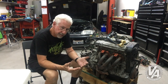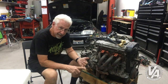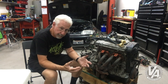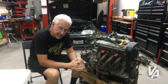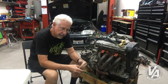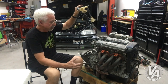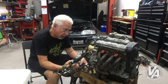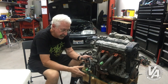We need to wire the harness for the engine now. The engine harnesses for the DX models are unique depending on the year: 88 DX harnesses are by themselves, 89 DX harnesses are by themselves, and then 90-91 DX harnesses are basically combined but separate from the 89. Not only the DX but also the standard model — the four-speed base model — and those harnesses are unique pretty much to the year. So we need to make sure we use the one that came out of the car. I had the 88 Civic harness that came out of the car, so the first thing we need to do is completely strip it of all the loom.